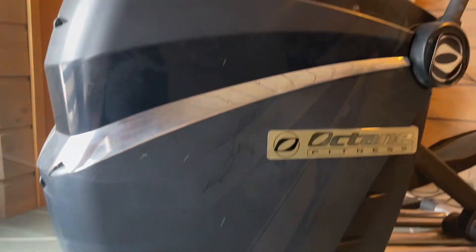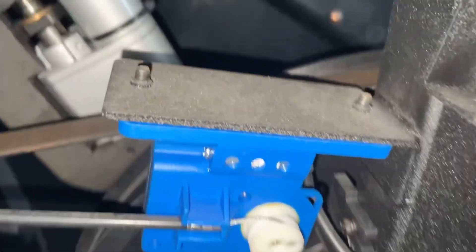Showing you just a few of the screws around right here. There are four on the top clamshell that you remove on the side. There's two on the console actually facing you where you work out. Once you've pulled those, you lift up on the cup holder like this and you pull the entire thing backward. On the side clamshells there are two longer screws at the base, then there's three along the front of the actual machine.